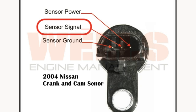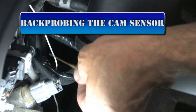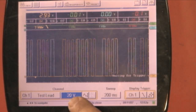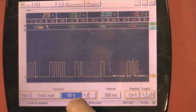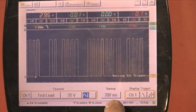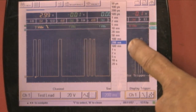This diagram is available on our website. Set the voltage scale to an amount greater than 12 volts — the higher the setting, the smaller the pattern. The entire cam sensor pattern on this vehicle is a 1, 3, 4, 2 pulse, identifying the relative cylinder. At this RPM, we found the best setting to be 200 milliseconds per division to see the entire pattern.